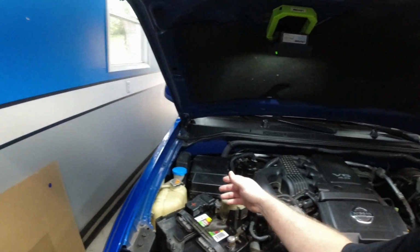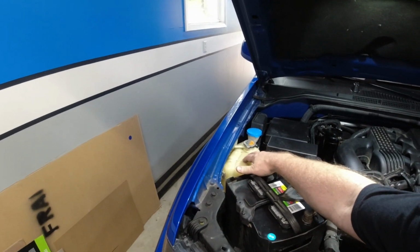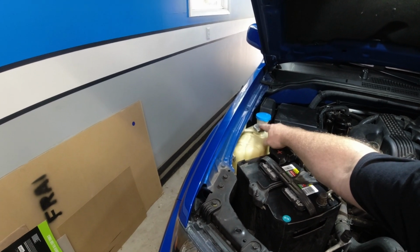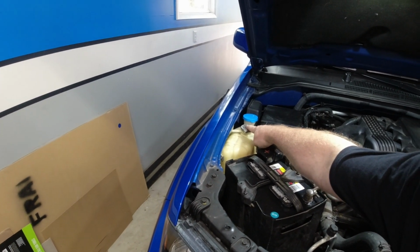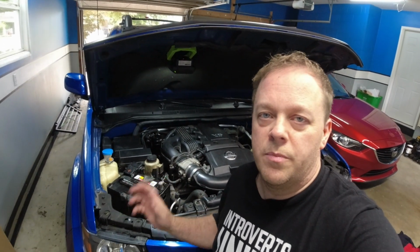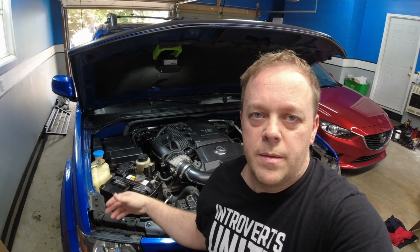And as I have said, when you're driving it, all of the air, because it's a closed system, will come back here into the reservoir, and it will be discharged because you have the pressure release valve here. So if this is working, you shouldn't have any reason to do a major burp to it. But I just wanted to point out that it's fairly easy to do. Getting this set back up, I didn't make any more of a mess than just removing the hoses.